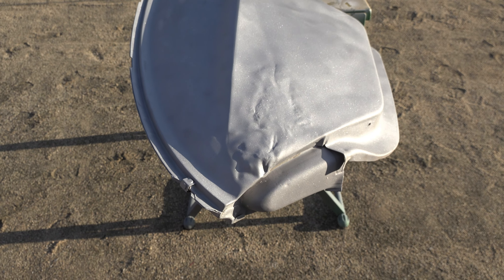With that done, I go ahead and tack-wipe the surface, and then begin laying down the Tamco high-build primer. The high-build primer will fill in any minor defects, and once it's sanded, will leave me with a totally smooth surface.